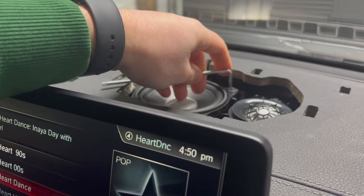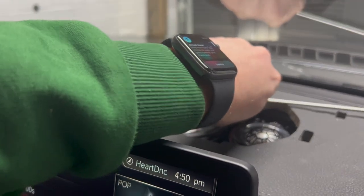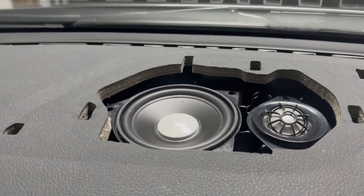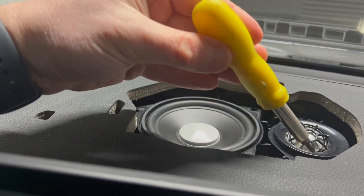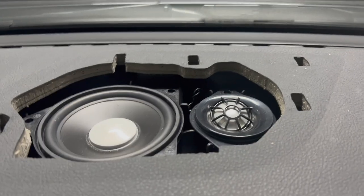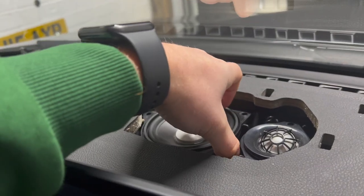After trial and error I think I found the right size of Torx. I don't actually know what size this is — it looks like it's a four or five mil. I'm trying to do this without touching the windscreen because I don't want to get greasy fingerprints on it. This is going to take a while and I might try and find a different length Torx driver. That was really quite fiddly and difficult, really annoying. I ended up using a combination of tools — a four inch driver to access one screw, and a really low profile driver for the other because there wasn't enough height. I could only do about a quarter turn each time so it just took forever. We should now be free, so in theory I should be able to just lift this up.